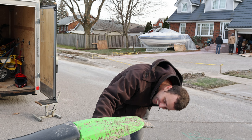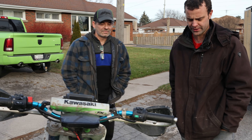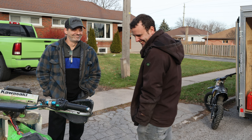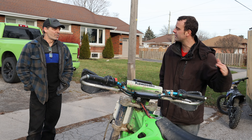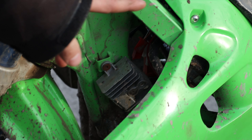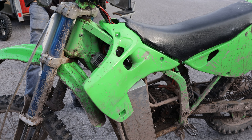Oh yeah, it'll just pull the front end. Do you have a 12-volt regulator on this thing too? Yep, for your lights — DC to DC, so that's 72 volts dropping down to 12. All 100% waterproof — trust me, I've submerged this thing, almost three-quarters up the wheel. What I like most about these electric builds is that forks are available, plastics are available — everything is available because I went with name-brand parts. Check out the size of that zero-gauge welding cable coming out of that battery — I use actual welding connectors, strong enough to handle the amps I produce.